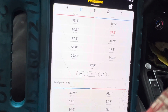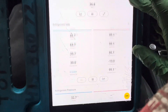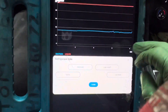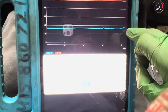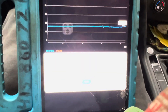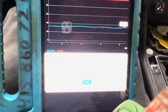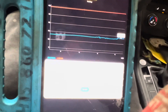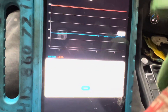I have a belt-driven compressor but it's variable displacement, and this is a very fast-acting one — it barely moves at all. I just let it sink back to idle. That's right when I took my foot off the throttle right there, and it's coming right back to where it was before I did the idle and messed with it. So variable displacement compressors — funny things happen. You don't get that high side raise and that low side going down like you normally do.